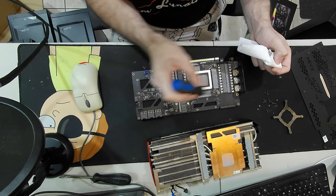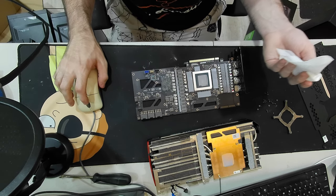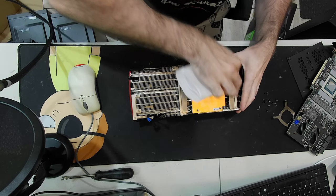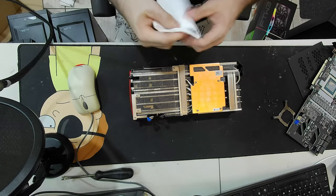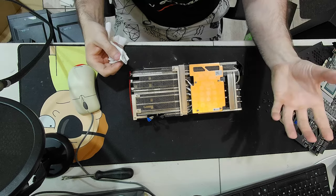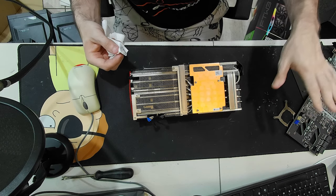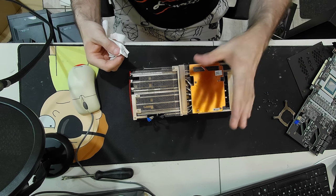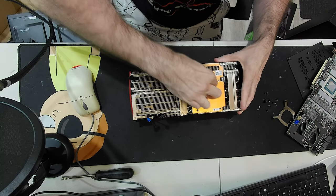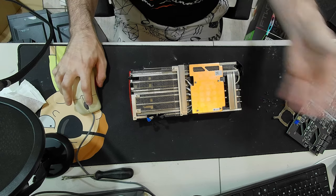There are a lot more phases here, which is good - obviously there are three 8-pins and it's a 450 watt out-of-the-box TDP. One more thing: if you are taking this apart, make sure you have 2mm thermal pads on hand to replace the foam. Because if you take the cooler off with all that foam and put it back, the foam isn't gonna sit the same way it did out of the factory - you might have air bubbles or gaps in your chokes. Just get thermal pads and replace it. Maybe that's why they use foam - so they can tell if you took it apart. Or maybe it's just faster on the assembly line. Either way, get thermal pads ahead of time.